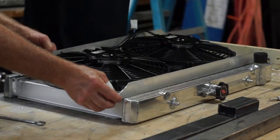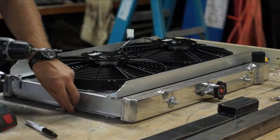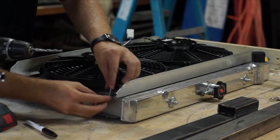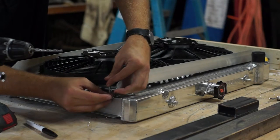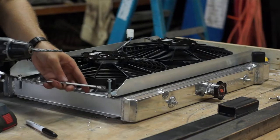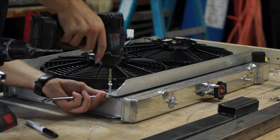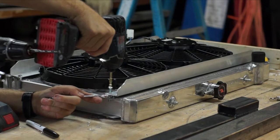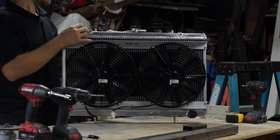My dad's just giving me a hand and checking out what I've done. The fans bolted down to the bracket are protruding on the backside — maybe a quarter of an inch — and I don't want that rubbing against the radiator. So I came up with the idea of using a nylon lock nut as a spacer, and driving an inch-and-a-half long quarter-20 that I picked up from Home Depot. I'm putting another nylon lock nut on the backside to make sure it doesn't vibrate loose.